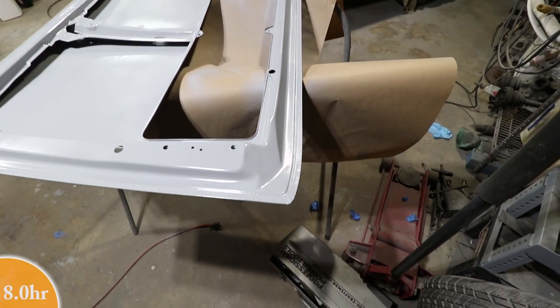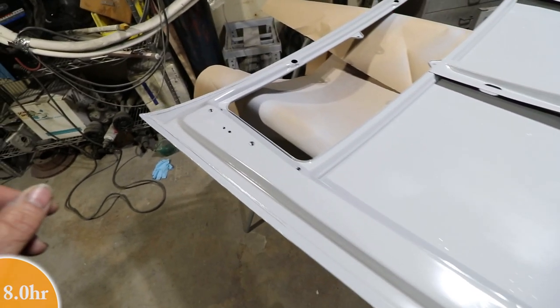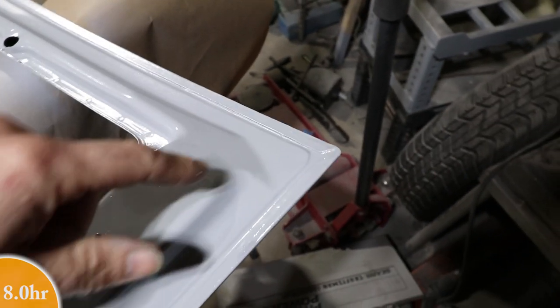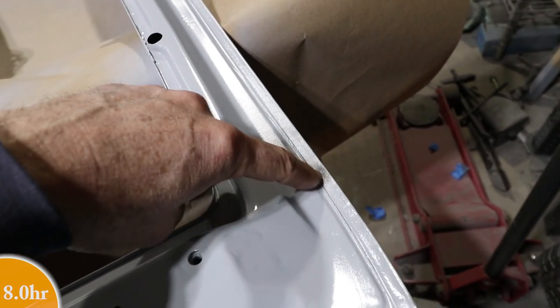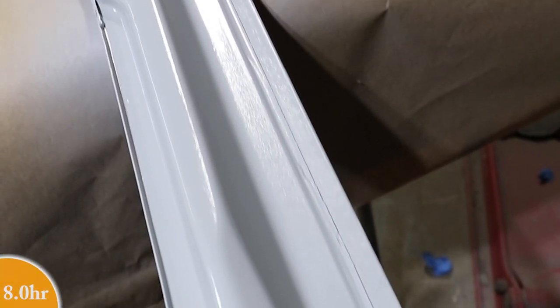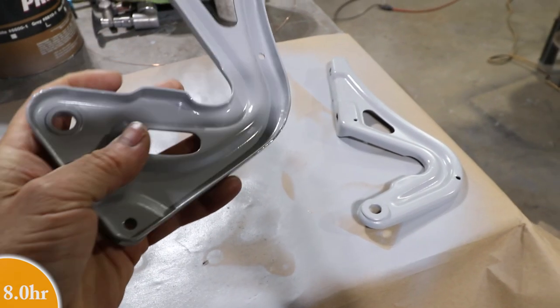This has been drying overnight — two coats of epoxy primer and it's looking pretty good. As always, everything really looks better when it's one color. I can see right here at the top corner the factory had some seam sealer in here, and it wasn't apparent until I put the primer on that it is cracked and wide open. You can see that crack along there — it extends all the way over to here. This little crack I know how to fix; it's easy to do, but this is really what takes time. I didn't see it before — I thought I was just going to scuff and shoot, cut a few corners, and the next thing you know you're going back and doing it again. I struggle with whether to leave it alone or make it look better, but I'm going to fix it. These hinges came out pretty nice too — they're going to need just a little bit more prep work, but they'll be ready for color here soon.